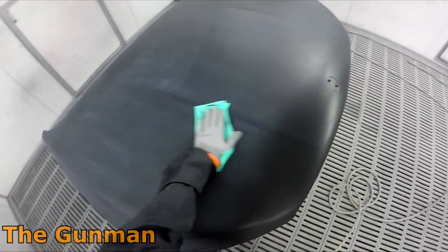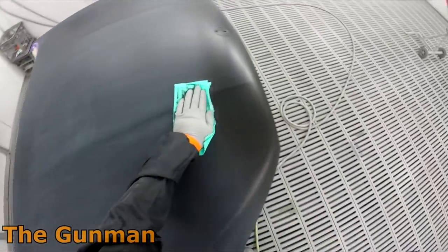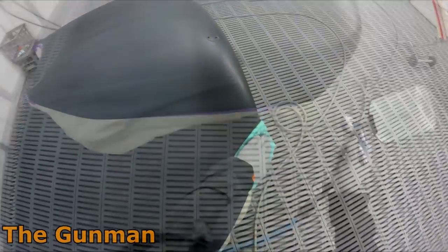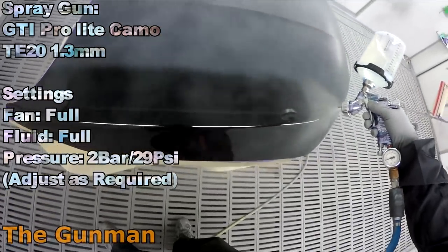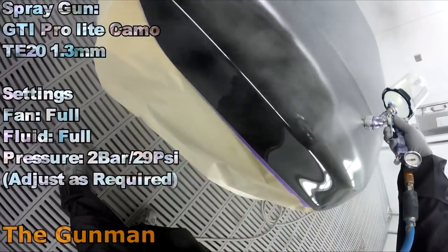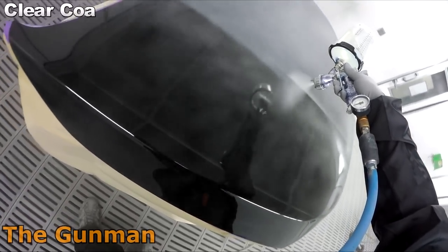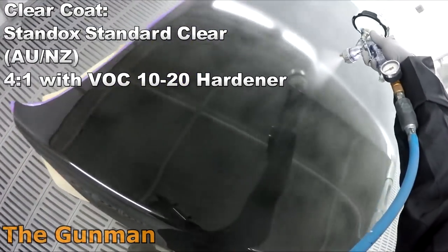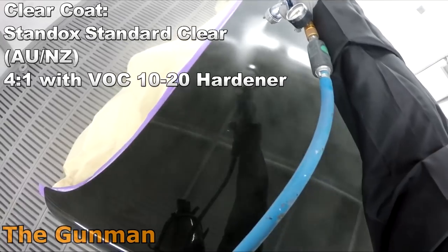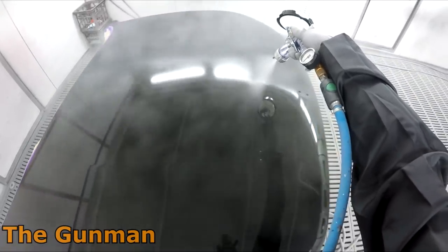I know some people just trust their color cards, but you can actually have batch variants in tinters. A tinter from one batch, although it's meant to be deep red, for instance, might be a slightly lighter version because of inconsistencies in batches. It's only a small chance of it happening, and it might only be a small difference, but when you're working on cars worth around $50,000 to $55,000 for the base model of these X250Ds, you're getting paid to do the job, so you might as well do it properly. That's the way I say it anyway.